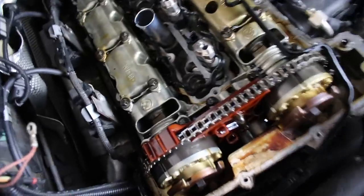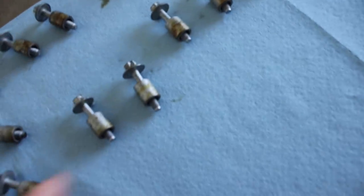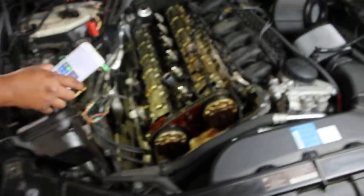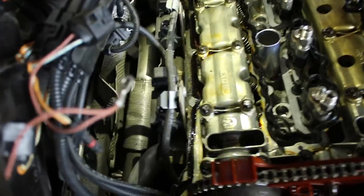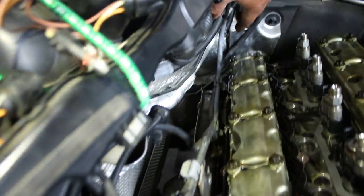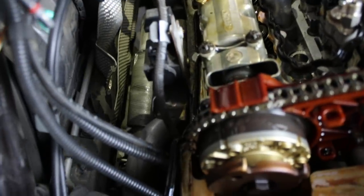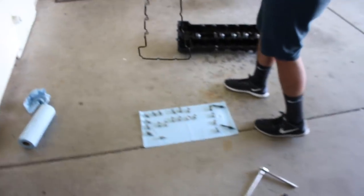We're gonna show you how bad this gasket is. These screws are like drenched in oil, especially the ones back here — that's where most of the smoke is coming from. The ones on this side are also drenched in oil; the ones in the middle are all right besides a few of them. See back here — the black gasket — on this half of the gasket on the left side there should be no oil, but there's still oil collecting here. That's mainly where it's leaking, just leaking and falling along your block down to your headers and turbos — that's where you get so much smoke. This is a really bad gasket. That's probably a hundred-thousand-mile valve cover; I doubt it's ever been changed before.